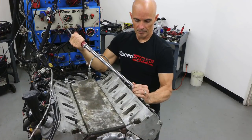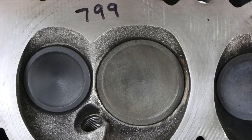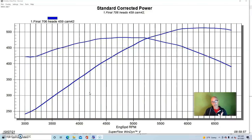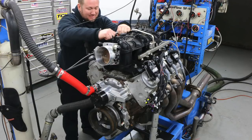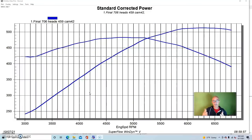To get things started on our cylinder head and camshaft comparison, on our 6-liter we're going to start out with cylinder heads — comparing factory 706 heads to 799 heads to a set of factory LY6 heads, which basically are the same as the LS3. The 799 is equal to the 243, and the 706 is the same as the 862, so all of those will interchange. We ran these on a 6-liter LY6 iron block — the same motor that made 1,540 horsepower in the Gen 4 Big Bang build. I used this particular motor for lots of testing, including this cylinder head comparison.